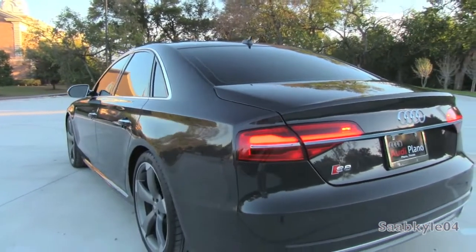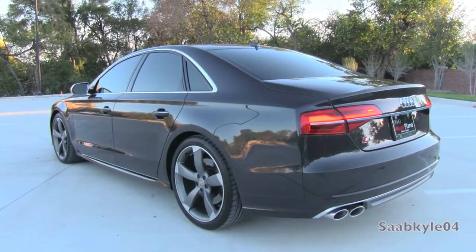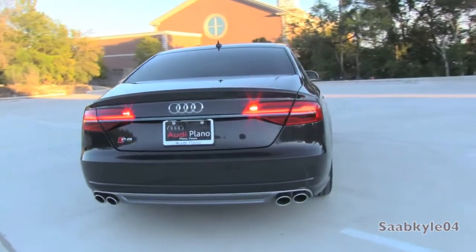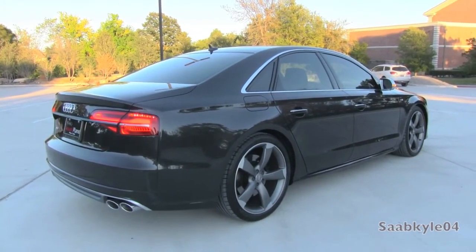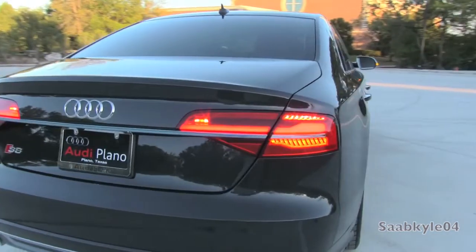To eliminate noise and vibrations when switching to or traveling under 4-cylinder power, the S8 uses active engine mounts that deliver contrasting feedback that's 180 degrees out of phase with the engine's natural frequency. There's even a fiber optic based noise cancelling feature that emits passive frequencies through the audio system to counteract exterior road noise to maintain a smooth and serene cabin.